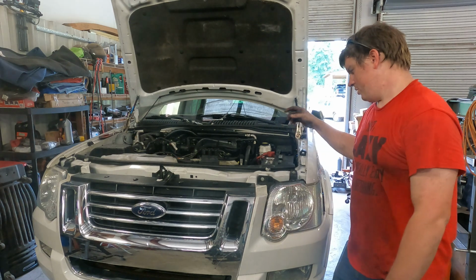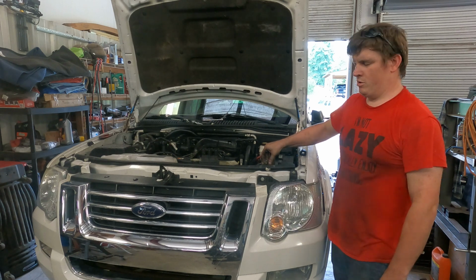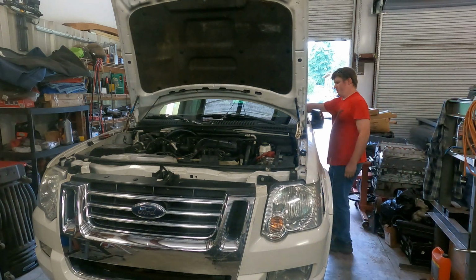All right, well, first thing is, we'll hook the battery up and hope it don't make some big bang noises and stuff. Oh, we're good. All right, and then I'm gonna prime the switch a couple times, check for fuel, make sure that we don't have nothing major going on.